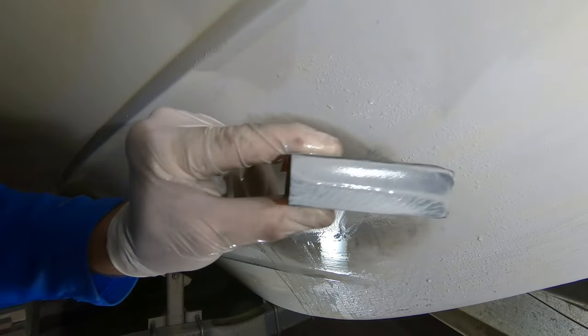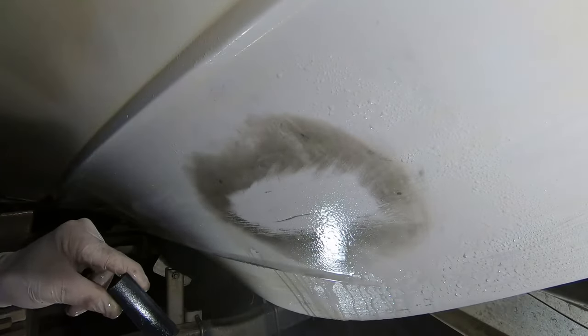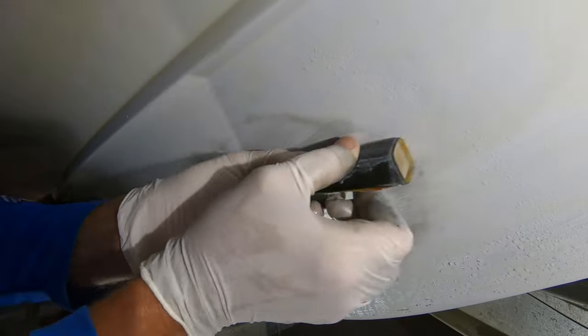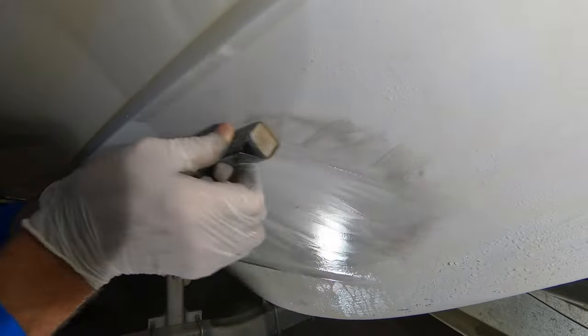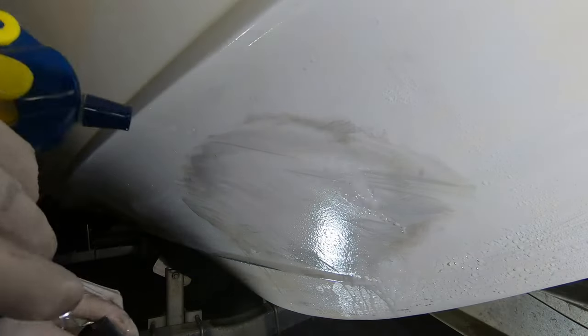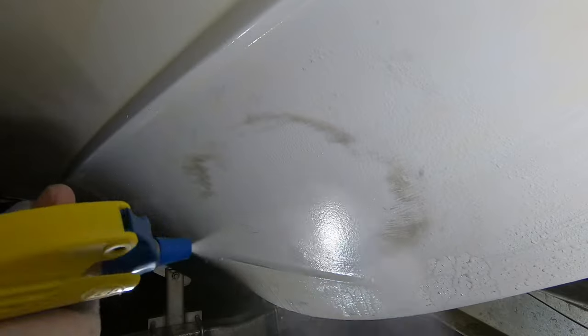You can see it's really cutting that material. Right here again, this edge — that guide coat really helps you see where you need to focus. So just like that, that was the first cut. We went with 320 on that one since we used the razor blade to scrape it off first.